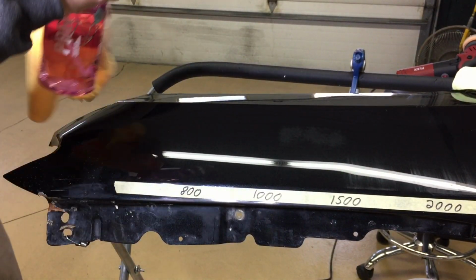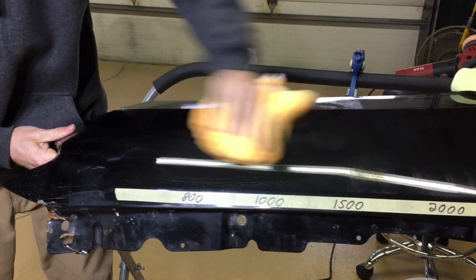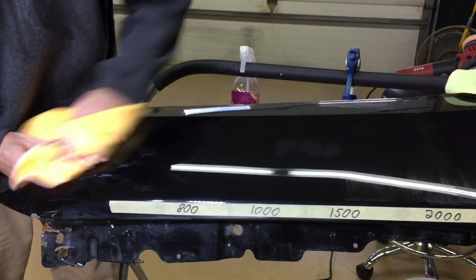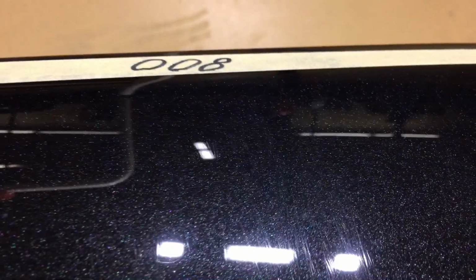Before we move on to final thoughts, NanoSkin likes to include their patented sealant into a lot of their products. So we're going to see if there's any fillers, silicone, or their sealant in the compound itself. We're going to use an IPA wipe and make sure that the sanding marks or the imperfections were not masked instead of removed. Both sections look the same. Nothing has changed. The compound has done a great job. Very impressive.